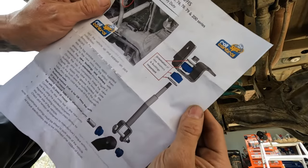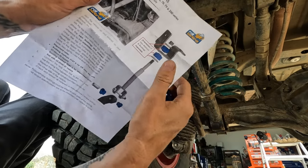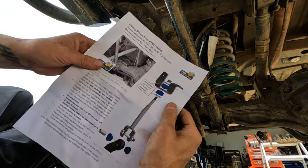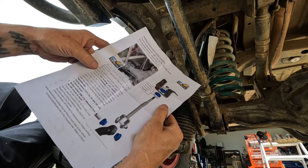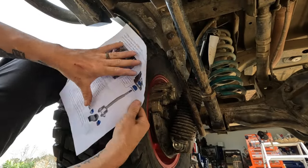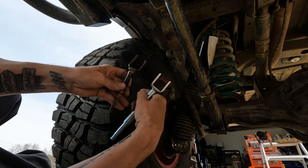Okay, here's our orientation. I think I may not have had it installed properly when I had this before. This time we're going to do it right. The instructions say to apply the supplied grease to the sway bar link spigot, then install the new bushings and washers referencing the orientation figure. To answer your question, no — I don't think this thing was meant to be bent like that.